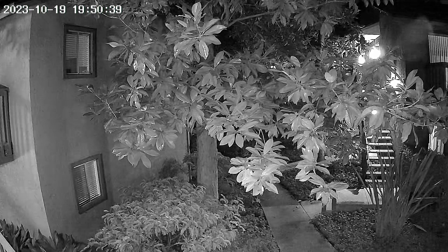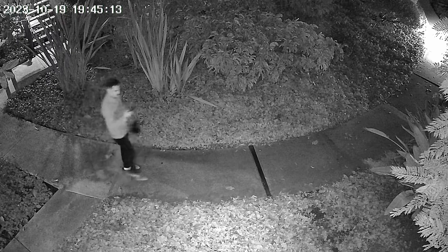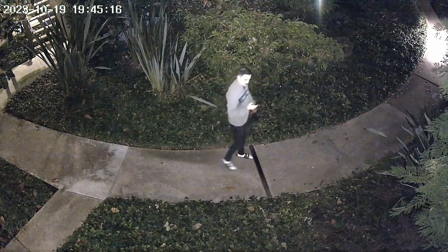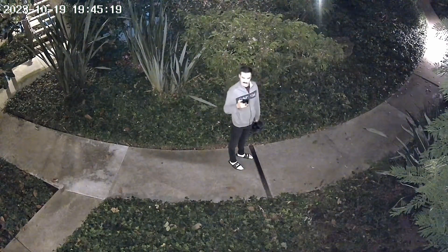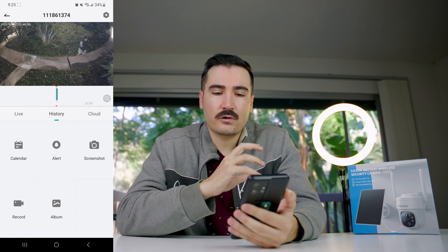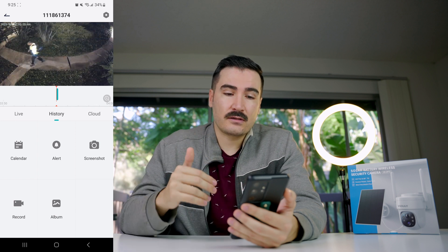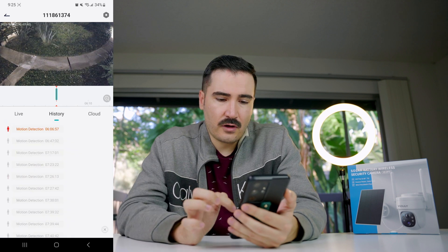In the app's full color mode, 'intelligent vision' is the auto setting — it captures color when there's ambient light and switches to infrared night vision when it's very dark. Motion detection works well: every time someone passes the camera it starts recording and sends a notification. Notifications can be disabled in the app, but the camera still records 10-second clips if an SD card is installed — and that feature is free.